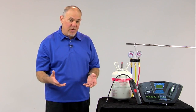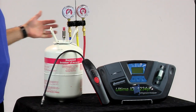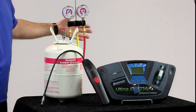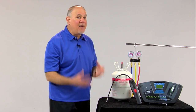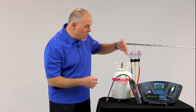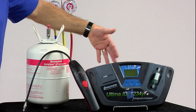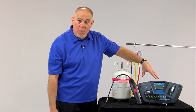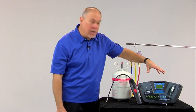So what are you going to need to work on an R1234YF system? You're going to need to acquire a few pieces of equipment that look and operate similarly to the equipment you're used to using on an R134A system. One optional piece of equipment is a standalone gauge set — you don't need these if your machine has gauges built in, but it's a nice-to-have. But there are a few items you're going to have to have: an electronic leak detector that meets SAE spec J2913, as well as a refrigerant identifier that meets SAE spec J2912 — this is if your recovery recycling recharge machine doesn't have one built in. Many of the new RRR machines have these built in. If your machine doesn't have one, you're going to need a standalone identifier like this one.